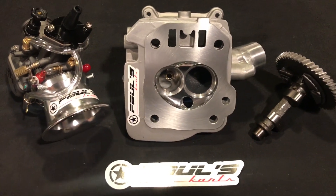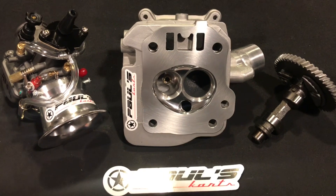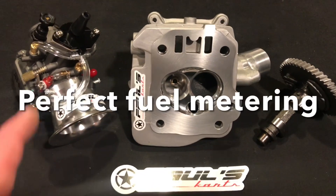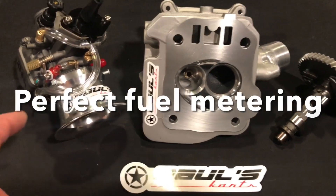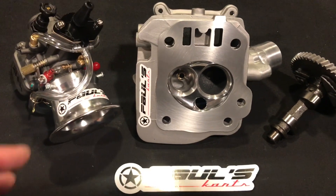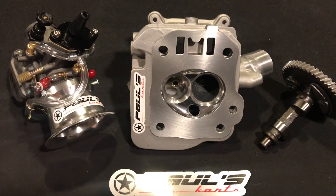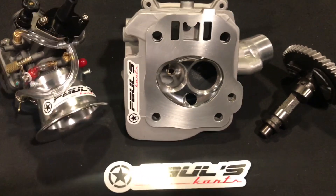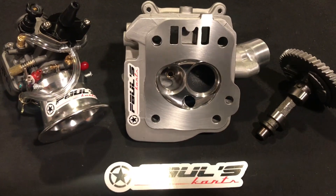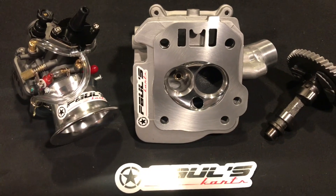When it comes to carbs — if the carb can hold, say on gas around 14.2 stoich, or if you're talking 13.8, if you can hold that fuel curve perfectly for the entire RPM range, it's a great carb. This carb can do that on gas and methanol. We have the setup for both — you select gas or methanol, whichever you want. It does come with the third circuit billet adjustable fuel valve so you don't have to get in there and jet it. You can basically turn that valve — we reworked it with some tubing inside and out — it's like an adjustable jet. Need a little more fuel, open the valve; a little less, close it up. It does have jets in the carb to fine tune if needed. They're close but not perfect — altitude and time of year can affect it. If you run into problems with the carb, give us a buzz and we can help you troubleshoot.